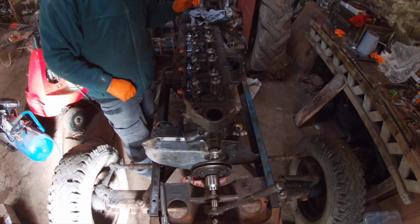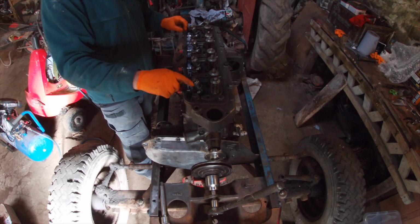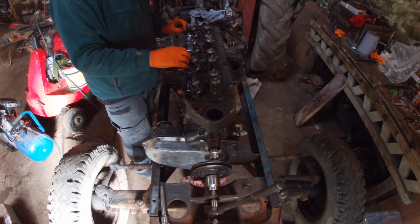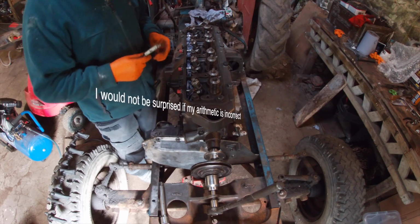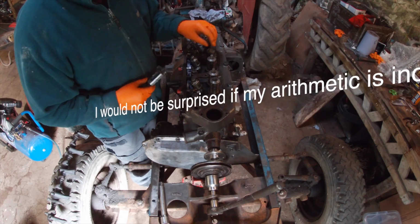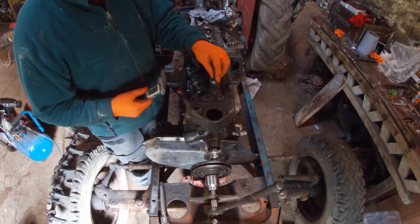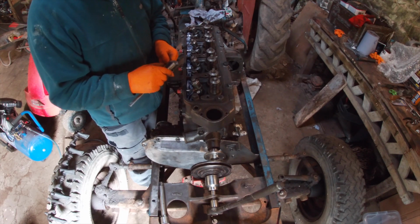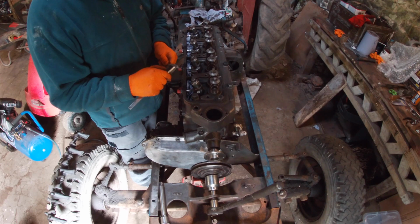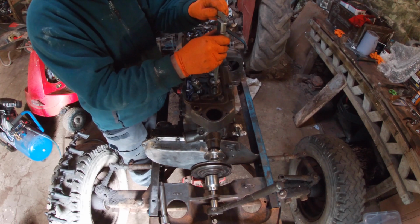I think what we'll do. Goes on there again. Oh, the little pipes that feed all this. Okay, I've decided to do a little bit more, but see how the pain levels go. So I've got the lash caps here, or whatever you want to call them. So it should be on top of here. It's got to be 1 to 3 thousandths. So we measure that.